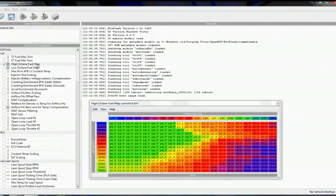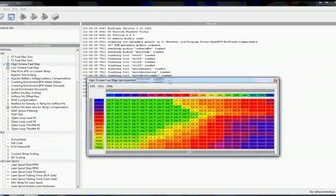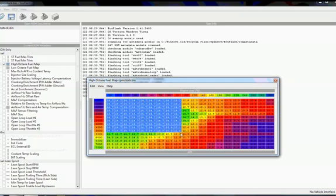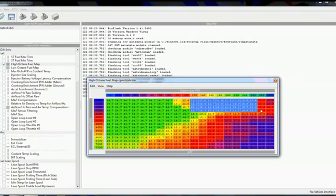And the fuel map is broken up into a few different versions, but we'll get to that in a minute. So what EcuFlash is telling us in this representation is that we have engine load on one axis and RPM on another. Engine load is effectively how much airflow is going through the engine. Up to about 100, you're looking at naturally aspirated. The turbo hasn't spooled yet. And beyond 100 is boost, positive pressure.